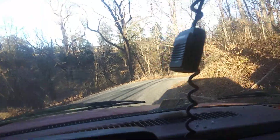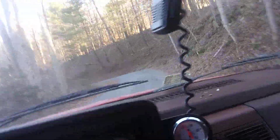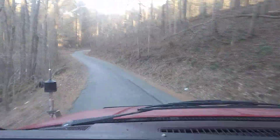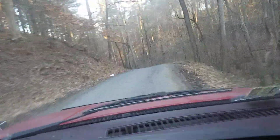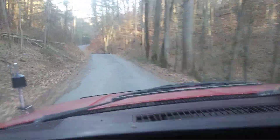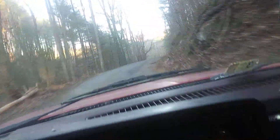Right now it sounds like an old muscle car. The 454 basically just splits into a Y after the exhaust manifolds and it's cut open — no catalytic converter, no mufflers connected right now — so it's just super loud and mean sounding. They put a little bit more of a torquey cam in it and had to bore the cylinder walls by about ten thousandths, so it's got a little more power. This thing just sounds like a beast.